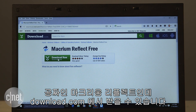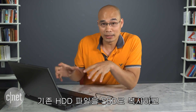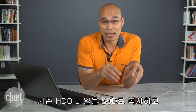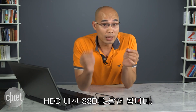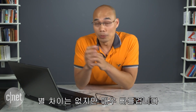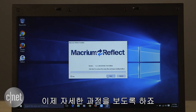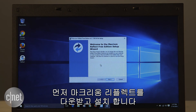Finally, you'll need cloning software. My favorite is the free version of Macrium Reflect, which you can get from download.com. The entire process can be described in one sentence: you clone the existing hard drive's content onto the SSD, then physically replace the hard drive with the SSD, and that's it. After that, your machine will be exactly the same — except much faster.